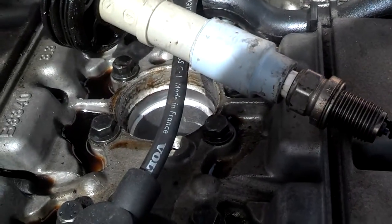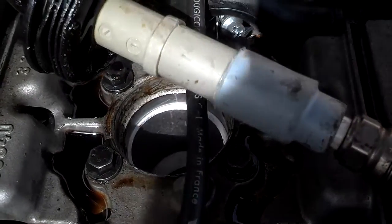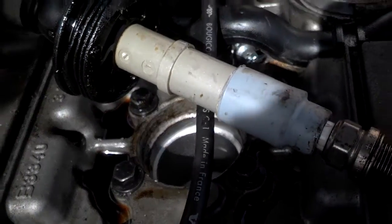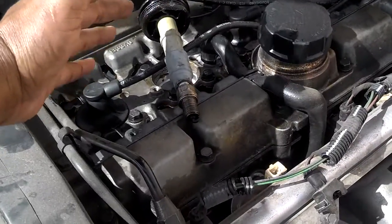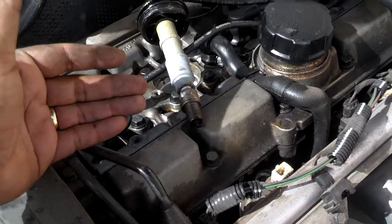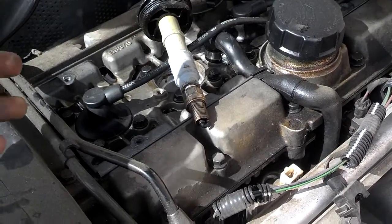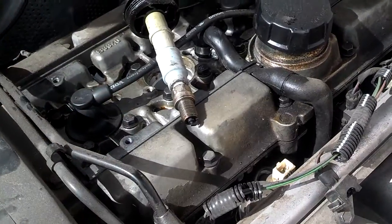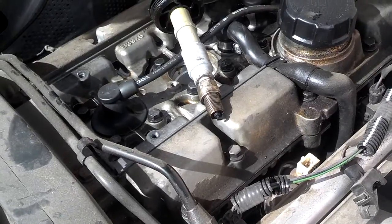You don't want to start the motor with the spark plug out and have fuel spraying in that cylinder, because fuel will spray out and you'll start a fire. If you have a coil pack that connects your spark plug, you can do the test the same way — unbolt the coil pack from the motor, leave the spark plug in it, start the car with no fuel on that cylinder, and see if the spark is jumping.